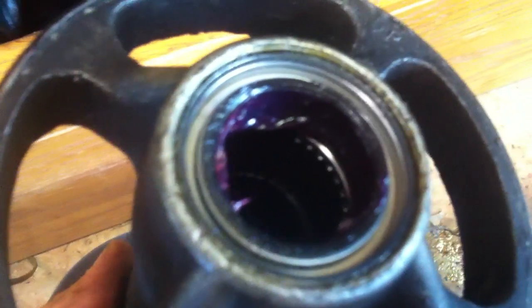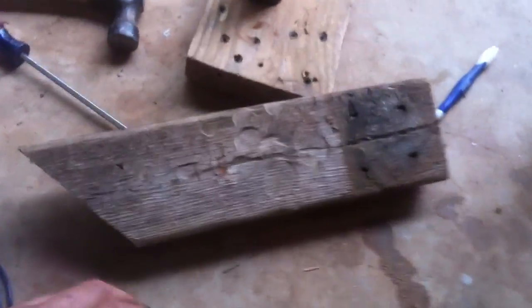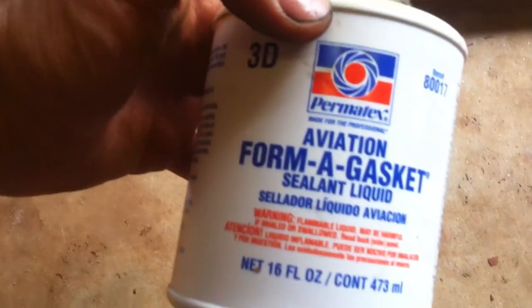When you put it back together, I've got my new o-ring, new oil seals, grease in the middle, and my o-ring goes in here like that. Then you've got your four bolts with seals. If you're doing this without the kit, make sure you get new o-rings — on the part schematic they're circular with a hexagonal cutout in the middle, not like a regular o-ring, so make sure you get four of those. Put some gasket sealer on that big o-ring so it doesn't leak, then tap it in with a rubber mallet — just tap it in, don't go crazy on it.